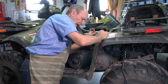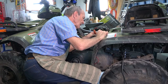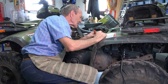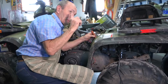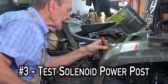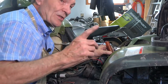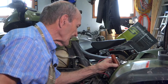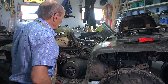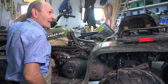Next, there's a cable that runs from the battery to the solenoid — it's only a short cable, about six inches, running to the solenoid. Let's make sure that cable is working. Touch the bolt that it's fastened to. We're getting power to one side of the solenoid — that's perfect. And now I need to check if the solenoid is working. You can see the solenoid is clicking.